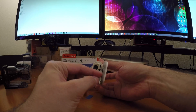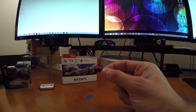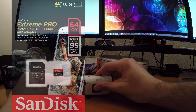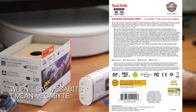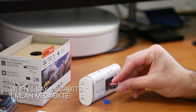I'm using the SanDisk Extreme Pro, and the main reason is it's a properly formatted card. If you're looking to get a card, you want one that writes super fast because the Sony X1000V can have a bit rate up to 100 megabits a second. In all my searching I couldn't find a card that writes at exactly that speed — some come close reading at 95 megabits a second, but I'm more interested in write speed. This card writes at 90 megabits a second, which is pretty close to the max capacity and pretty much the fastest card I can find on the market.